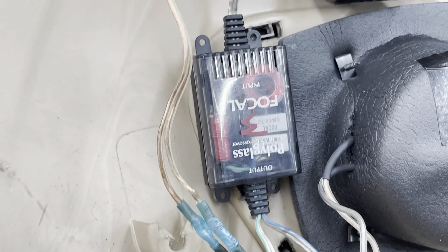The speakers are actually in the front door already, and the tweeters are on the door panel switch here — tweeters mount right in here, so I don't got to worry about all that. I just got to go ahead and wire up the crossover, and I'm probably going to put the crossover inside the door. The kick panel is in there — I'm going to just go ahead and toss the crossover for the kick panel inside the kick panel. And I'll probably put those quick disconnects on the kick panel too, so if I ever need to get the kick panel off I can just pop off the whole quick disconnect and the entire kick panel will come off.